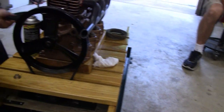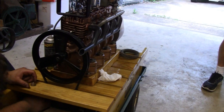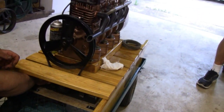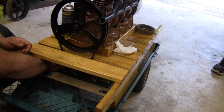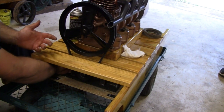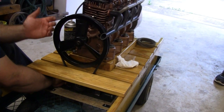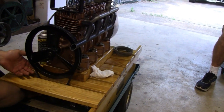So now, Mike, I don't know if the battery's charged enough. It seemed like it was charged. Well enough, it'll work. It just wasn't worth working on our other one. We get these generator starters for $5 at the shows. And this is a long-frame starter, too, which might have a little bit more torque, which would be handy on a four-cylinder engine. The armatures are longer, the poles, the stator are longer, I don't know. But whatever, it's going to work.